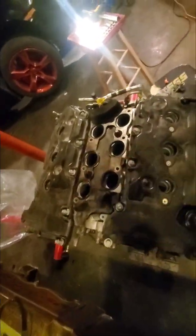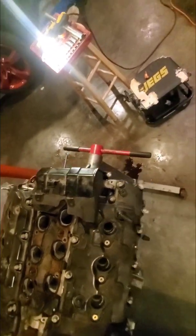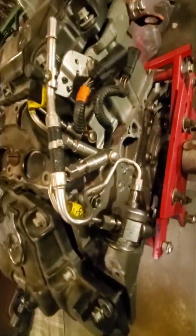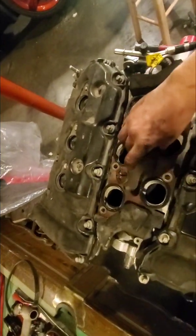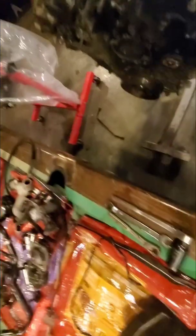You're going to see this harder plastic piece — this is going to be covering your direct injection. It comes from the fuel pump, and then from the fuel pump to the direct inject, which boosts it up through a pump to around two thousand-something PSI. That's on the back — it's the actual pump that goes into your valve cover and runs around one of your cams to take the pressure up. You can leave that on; you don't have to have it off. Once you take the top off, there's a foam insert — pull this foam insert up and out. All it does is protect and heat shield. That's where your direct inject is.